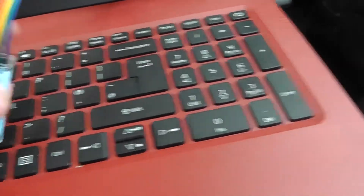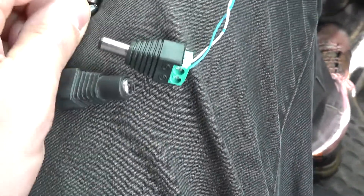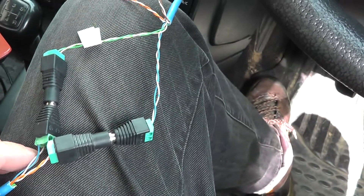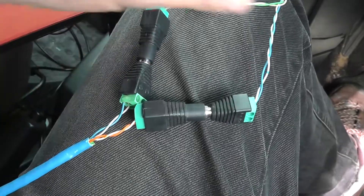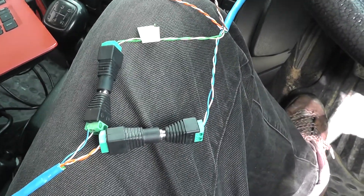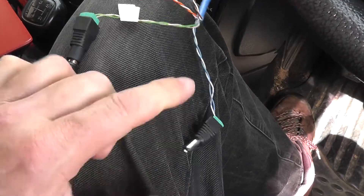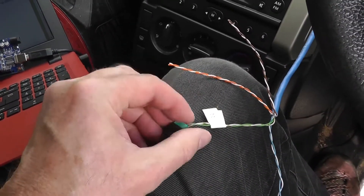The reason I did that is because I want to figure out what happens if the dash is completely disconnected from the rest of the car. To find that out, all I have to do is pull that out. If I plug both connections into those connections, they go back to my CAN reader. The orange-blue are twisted together — that's CAN high — and the two whites are twisted together — that's CAN low. So basically it's teeing into the CAN bus system.